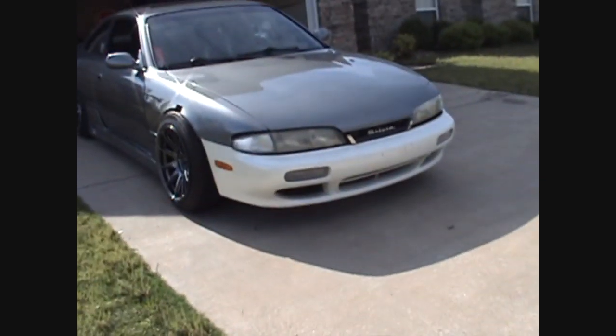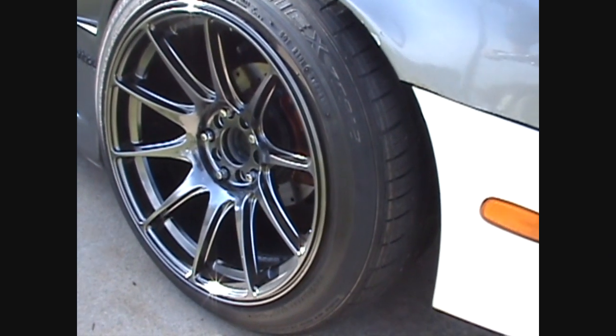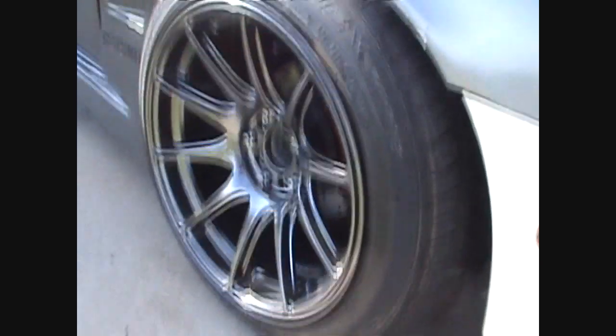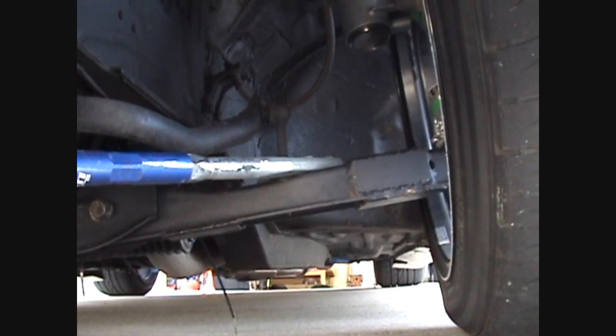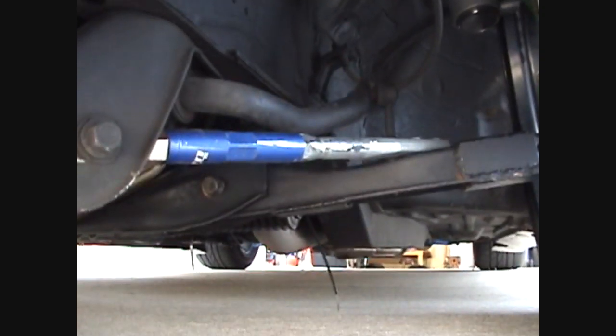Here's an update on where the car is at now since I've hit a few drift events and learned a lot. I got the 527 XXR wheels, 17 by 9 and 3/4, on a Vulcan 235/45 tire — pretty worn out since I run between four and five degrees of negative camber. I'm on extended and boxed lower control arms about 38 millimeters, a 15 millimeter hub-centric wheel spacer, and my angle mod is chopped and dropped knuckles.